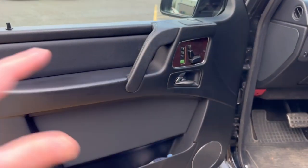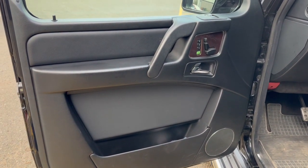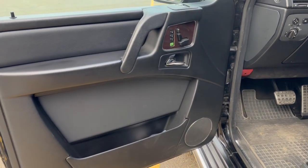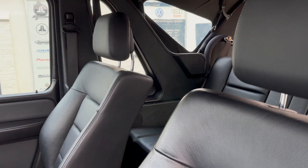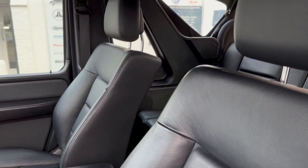Needless to say, we've stripped this down. We've added four layers of soundproofing: back of the door card, regulator panel, the lovely soft foam, and the inner door section. So we've tried to get that Focal driver to work as efficiently as possible. We also had a set of Focal 5.25 coaxes - you can just see the grill there - in the rear quarters for a bit of rear fill. They weren't actually sealed either, so we've done quite a lot of work in there.